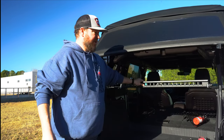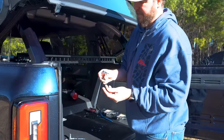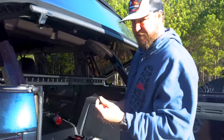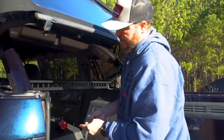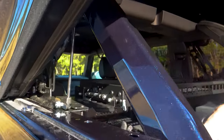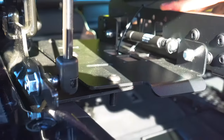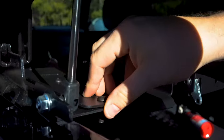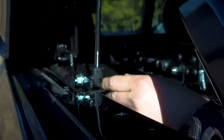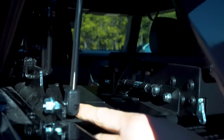We can center that up as we get our bolts tightened. I'm going to drop the next six bolts into place and start tightening those. You're going to need a 3/16 hex key or Allen key and a 13mm socket or wrench. Drop these bolts through the three holes on the bracket. You may notice this sags a little bit — this will tighten up.